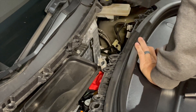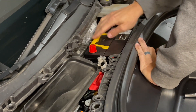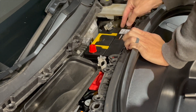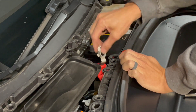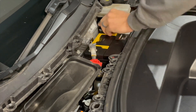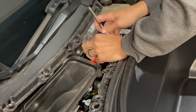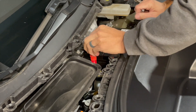At this point you can pull your 12-volt battery out and put your new RealDealEV 12-volt battery back in. Remove your plastic covers for your 12-volt leads, install your negative, install your vent tube, install your positive — you're going to see a little spark there. Then you're going to want to tighten each one of them up. Check to make sure it's tight, tighten up your positive, and slide the little cover over the lead.